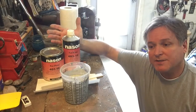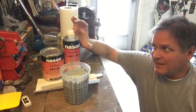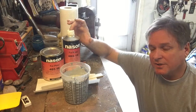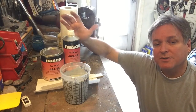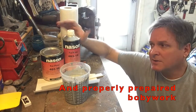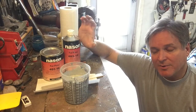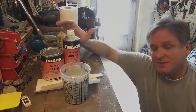There's a lot of mystery around epoxy primers, but they're not really that mysterious after all — it's just a chemical. It is unique compared to most of the other painting materials you're going to use. Epoxy primer is one of the best primers for corrosion resistance on bare metal. It'll seal that bare metal, but epoxy primer is not a sandable primer. It's not a high build primer — it's strictly for corrosion resistance.